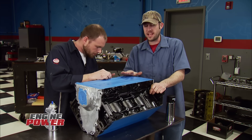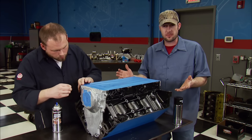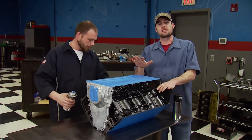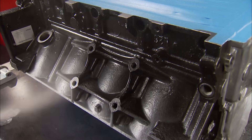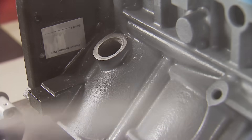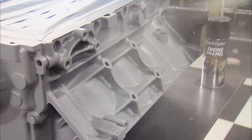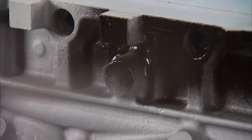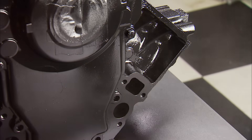We're back, the masking job is finished, and we're ready to add a little color to the block — our washer gets a little aggressive, so this is the last step before assembly. We'll spray a few coats of DupliColor's high-heat gray engine primer so the paint has a good base, then apply some even coats of their semi-gloss black engine enamel with ceramic, rated to 500 degrees.